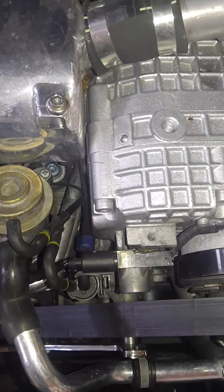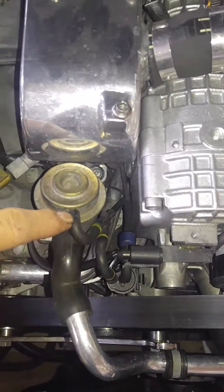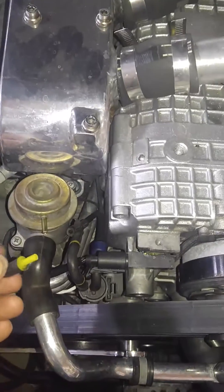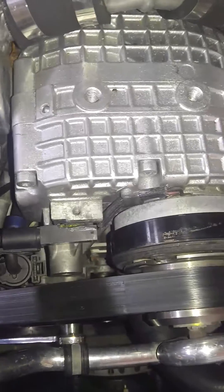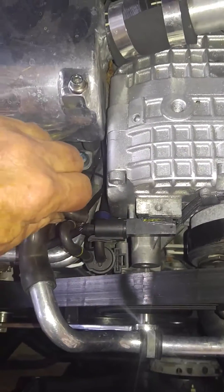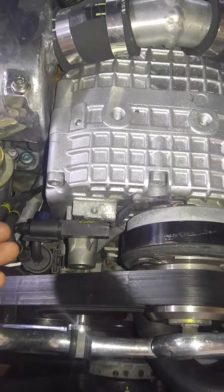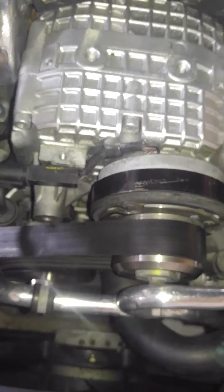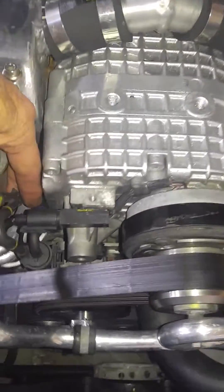If you want to check your car the simple way, put a vacuum gauge on one of these hoses. If you take this off and measure the vacuum on that hose down there, you'll be able to see if it's working. This is when the engine is cold. You can also use a T like I did — that way you can monitor the vacuum and have it connected at the same time.